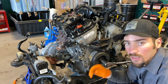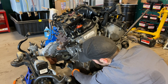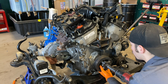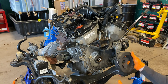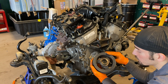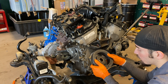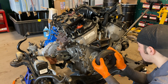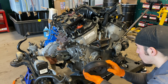If you have not drained the oil, now would be a good time to do so. These crank pulleys are not keyed — there is no woodruff key on them, which is why there are no timing marks on them. Once you get into the cover, obviously there are going to be marks and everything needed there.